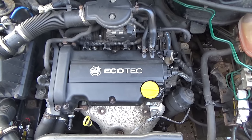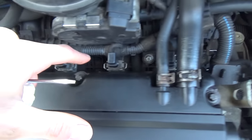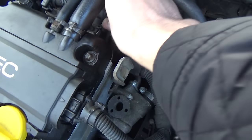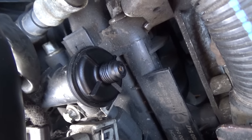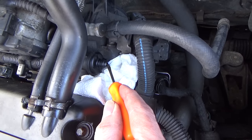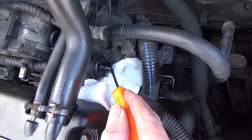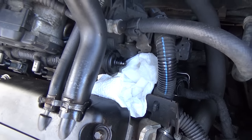Here we are in the engine bay. First, locate the fuel rail — the injectors are all here, so this is the fuel rail. It goes all the way across and on the very end there's a screw cap which you need to remove; the valve is just inside. It twists anti-clockwise. I'm going to put some tissue down here to stop any spillage, then push the valve with the screwdriver to release the pressure. You get a little squirt of petrol come out and now it's stopped — pressure is relieved and it's safe to take off the fuel filter.